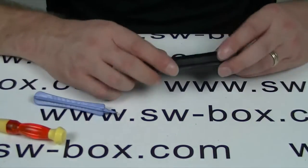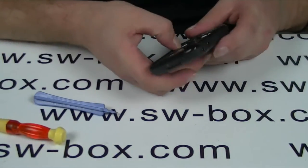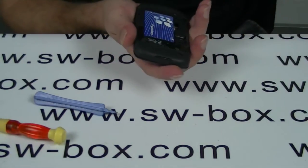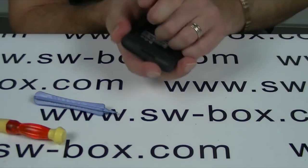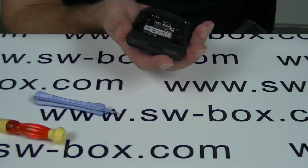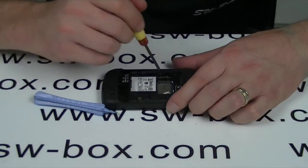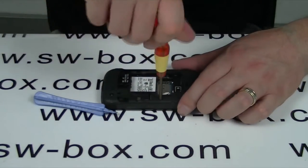Now taking it from the back — you want to take off your battery. Back cover off, battery out — move that out of the way, you won't need them till later. There are two Torx screws — one there and one there. Let's take them out first.